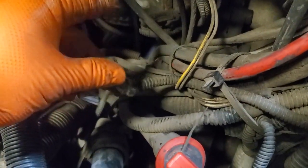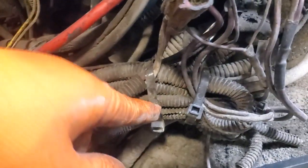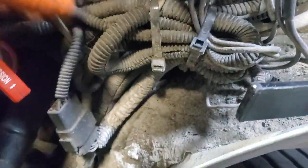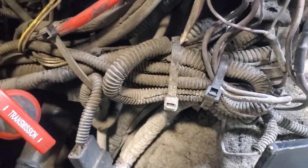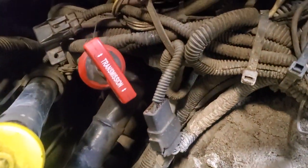If you do, the next thing to do would be to go to the ECM connector and test the pin that this circuit goes to. But I'm just going to pull this wiring apart here to have a look, just because I might get lucky and find something before I go down to the ECM, which is way down in there — kind of sucks to get to.